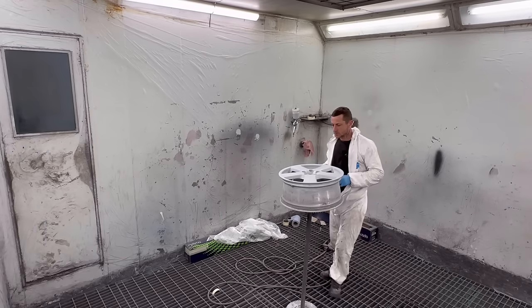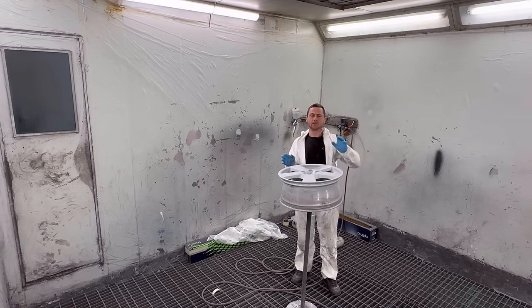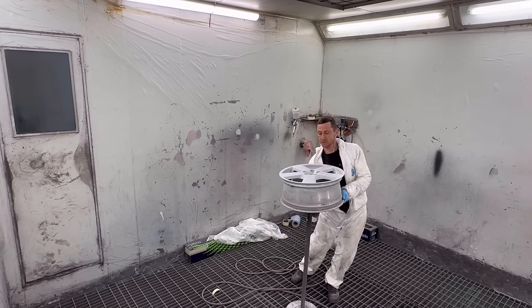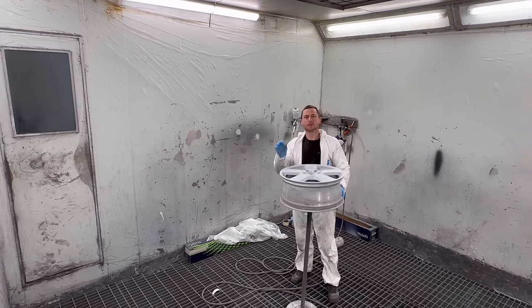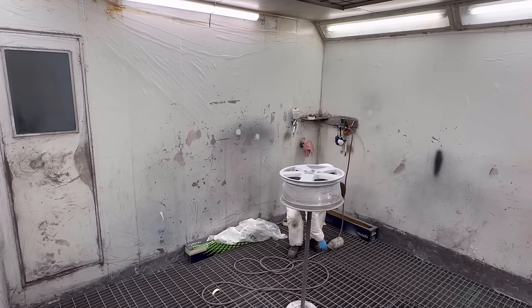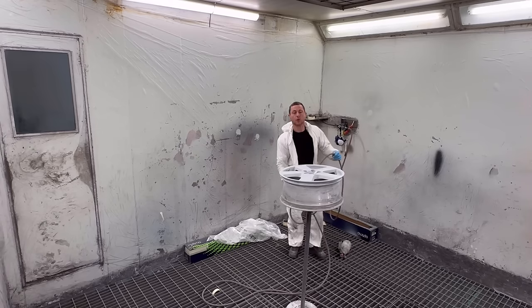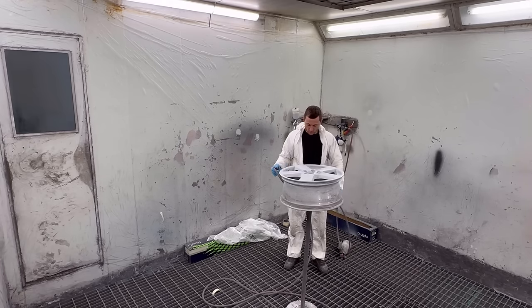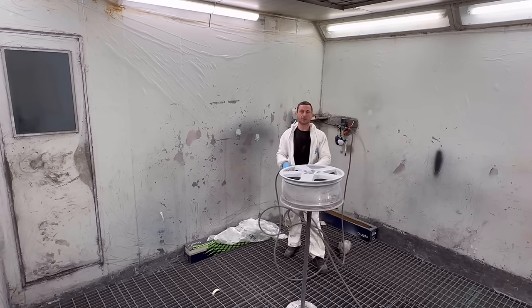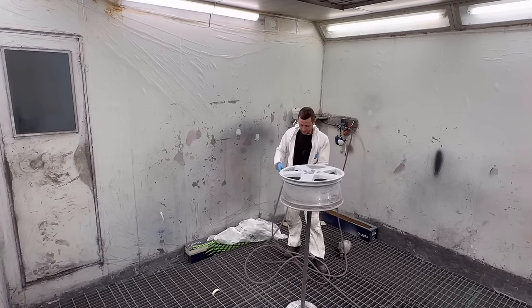We're in the booth. Wheels are all rubbed down. I rubbed them down in the time lapse — it was actually last night — sanded the lip down a little bit more, went round them, and then went over them again with the 320 to smooth out any rough marks. Andy can sand stuff down, but sometimes it's got to be perfect — finessed. I finished them last night and then I got Andy to red scotch the face. We're painting them in a single stage — a single stage is quite thick so the colour and the shine are all in one, so no lacquer.